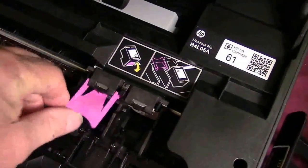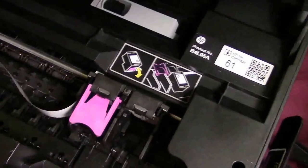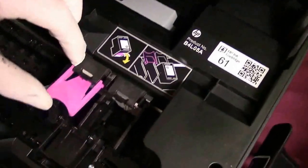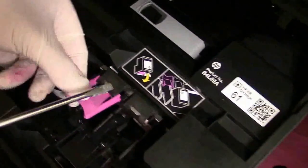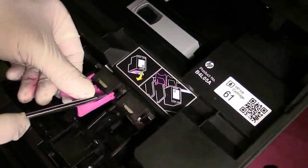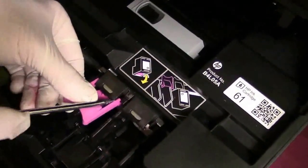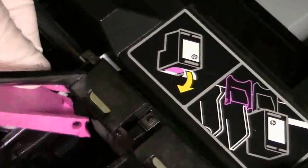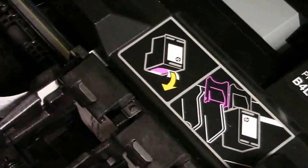So now we're going to take a flat blade screwdriver, go between that and the frame — I'll zoom in — there you go, it comes right off. On some printers, like the Envy and some of the older printers, they use the cartridge clamps, but on others, like the newer models, they don't. Save those clamps should you ever have to put them back on.